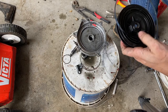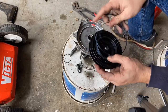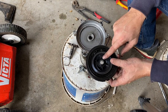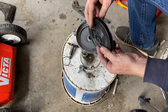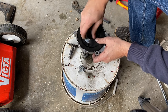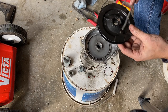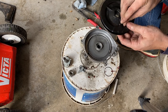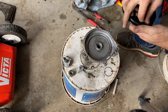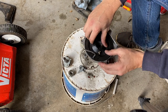I've got all that oil off the spring. Now let's start the tough process of getting this spring back in - it's probably going to take quite a while. So we've got that spring cleaned up. What we want to do is just flip this over - this little hook just has to catch on there as it goes on. Flip that over, line it up roughly into position, and then we can turn it in the direction the pull starter will pull. We can feel that's making tension so we can release that back off. At this stage we can put our cord back in. It would probably be advisable to put a new cord, but I don't have a new cord, so just put the old cord back in and wind that around.